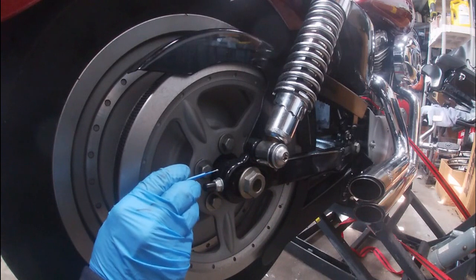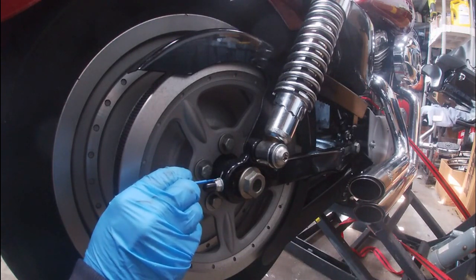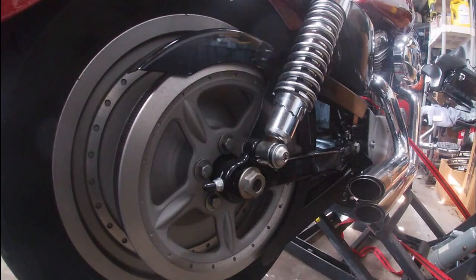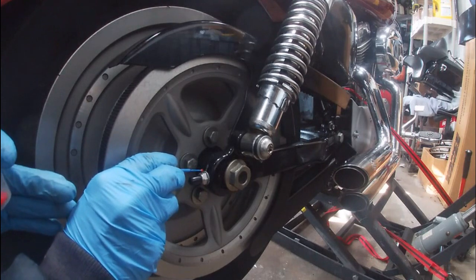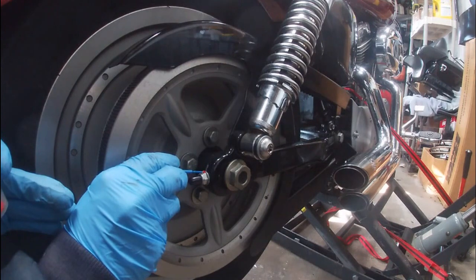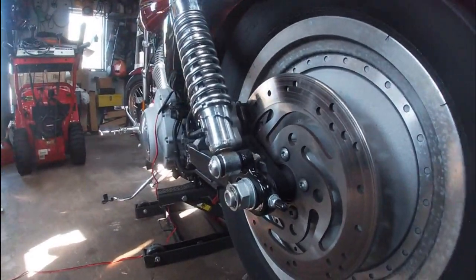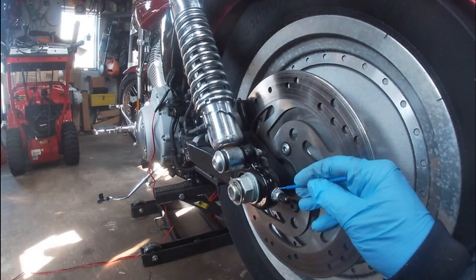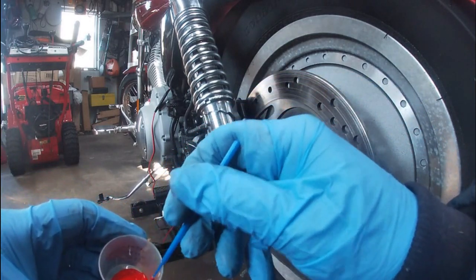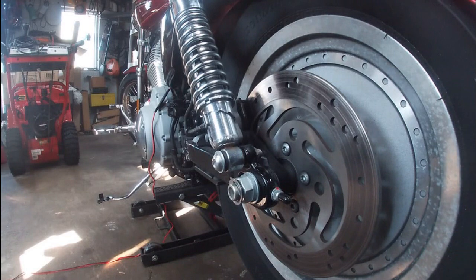We're going to do the same thing right on the swing arm, straight down, and then on to the nut. I think we'll have to use red to mark the nut, but the swing arm's now marked. I'm back with some red — there we go, that's one side. We'll mark the other side and then we should be good to go so I can start disassembling the rear tire. That is perfect — once that paint dries I have my marks.